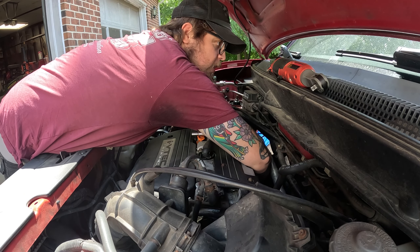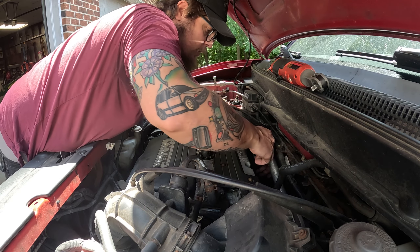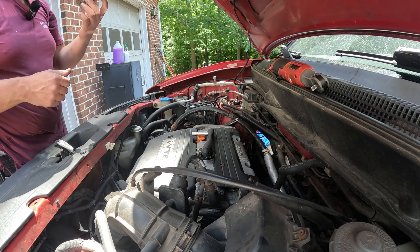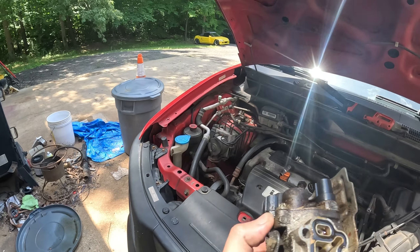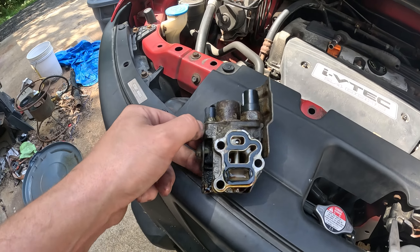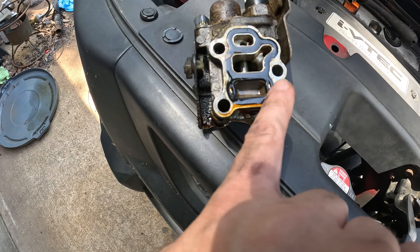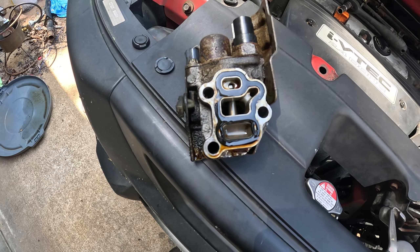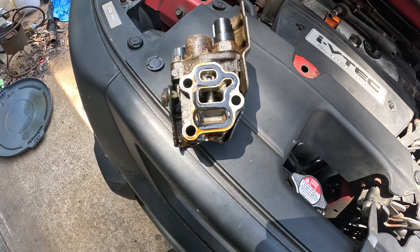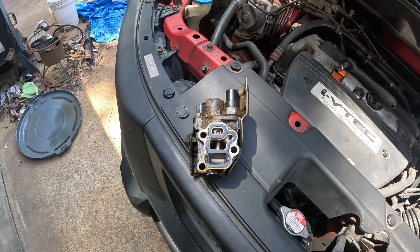Here is my last bolt — go ahead and there's our VTEC solenoid gasket right there, which it does look kind of messed up. As you can see, this thing is covered in oil. I know it's been leaking for a while. The gasket is pinched. I can only assume that's where it's coming from. I'm going to pull this one out, put the new one in, and clean everything up so I can tell if it's still leaking after I do this.